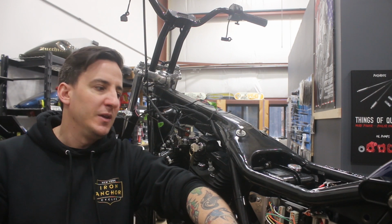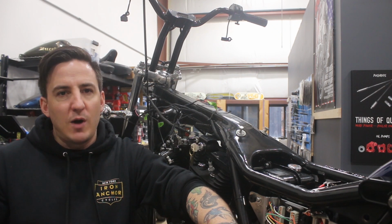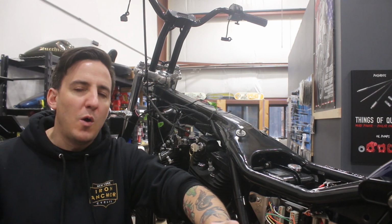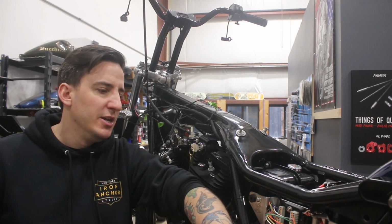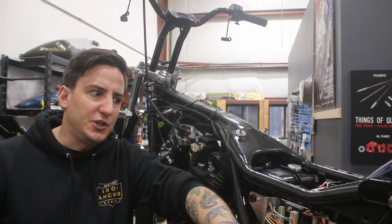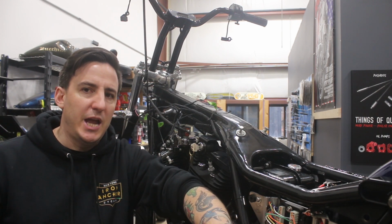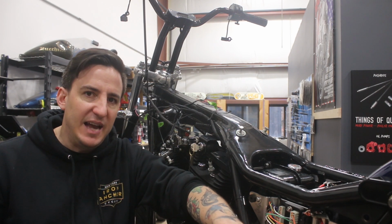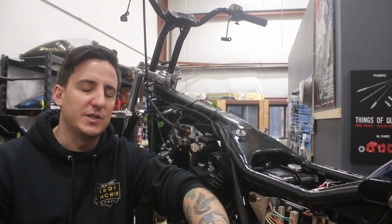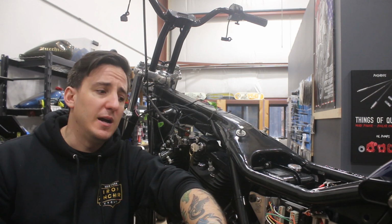In your factory switch housing harness, for example, there are going to be wires that are tied together. There are certain wires you use, certain wires you don't use. The headlight circuit is a little different. There's one wire that we don't use that's coming out of here. So it's all doable, and I'm not trying to say it's not. I definitely think it is. It's going to be fairly time consuming to go through and really get a handle on the full, complete wiring you've got and understand what inputs and connections need to be made, and then outputs on the other side. So it's doable, and still very, very time consuming.